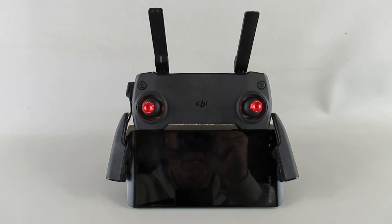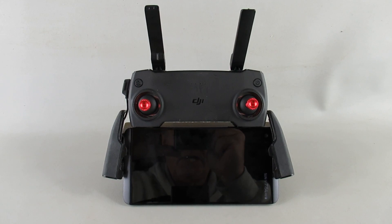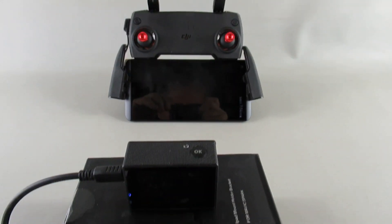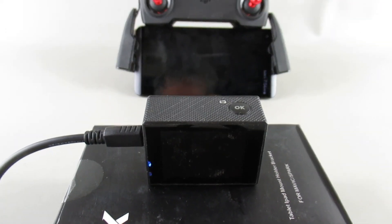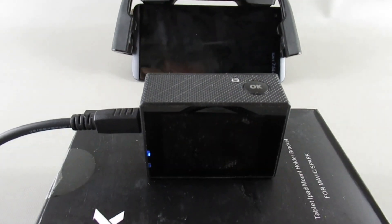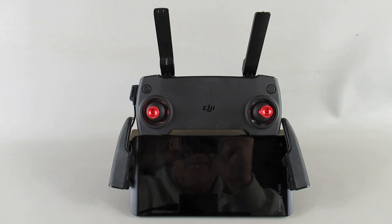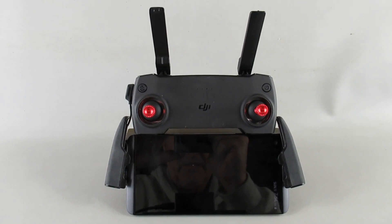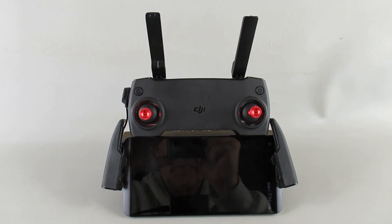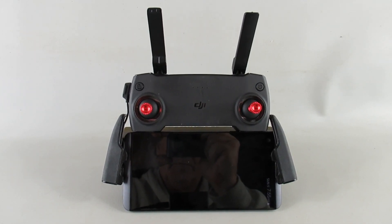The specification for a fully charged RC is 100 minutes, and I'm going to verify that. I also want to see, as the LEDs change on the controller as it discharges, when each of those kick in. I've got an action camera set up — kind of like a GoPro — on time lapse so it'll record for many hours to tell me the time each LED turns off. From that I should be able to put a chart together showing the discharge time for each LED going out. One thing I don't know is, when the last LED extinguishes, does charging stop — does the RC shut off? A few things I'm trying to learn by doing this experiment.